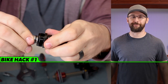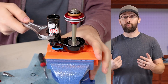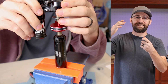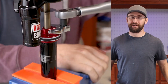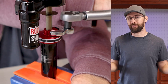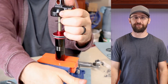Bike hack number one for this RockShox rebuild is that you don't actually need these crow feet sockets like the service manual recommends. I picked them up because it was my first time and I would have liked to tighten things down to spec, but sometimes you were actually tightening something that had a crush washer and it would max out with no way to tighten it further. When tightening the damper, it says to tighten it to 40 newton meters, but my torque wrench doesn't even go that tight. I'd only recommend the crow foot or a regular wrench for the IFP reservoir.